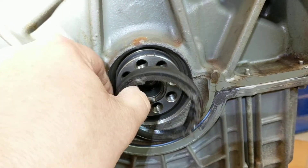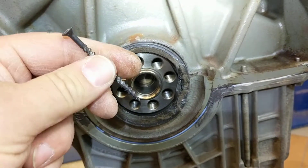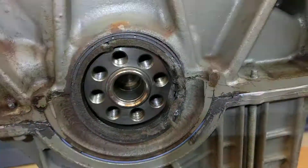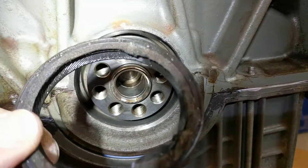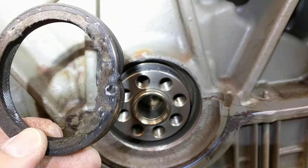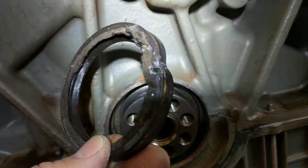According to the removal instructions, I used a wood screw and put it into the side of the seal, then tried yanking it out using a pair of vice grips. There are plenty of videos online showing how to do this and it works fine, but in the case of this particular seal it didn't work — the screw ripped out of most of the spots where I tried screwing it in.